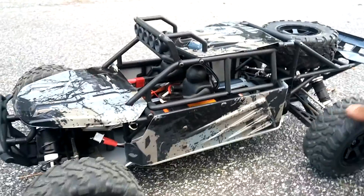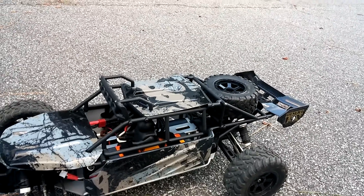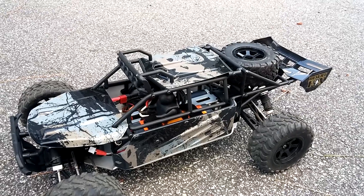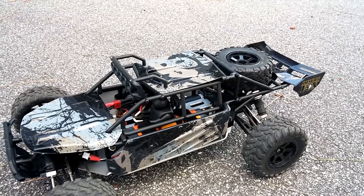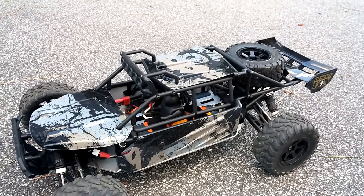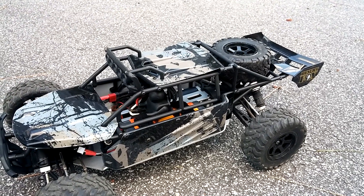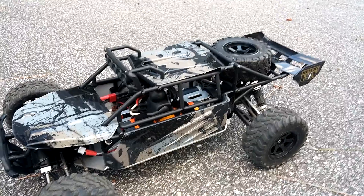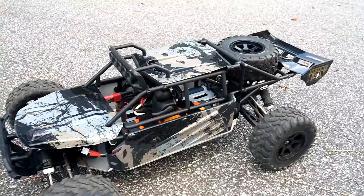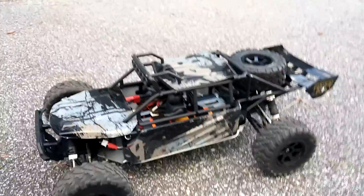This compound is pretty good on these for what it's worth. I'll probably end up replacing these at some point anyway. With the spur gear, these cars use that weird 0.6 mod — the same type that Red Cat uses, and Tamiya uses on their cars. So I got a Tamiya 19-tooth pinion gear in here; the standard is about a 25 or 26, so it is geared down a little bit lower. I believe Red Cat or even the Value Hobby trucks and cars can fit in here, and it may look like even the Associated one might be able to. I'll take that apart and look at it, but I'm not going to do that just yet.